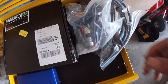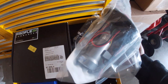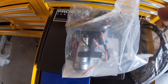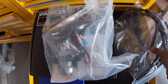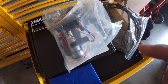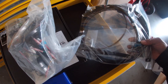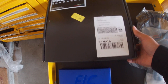I just made it back from McKinney where I picked up the new fuel pump. This is a single fuel pump — a 450 pump — and this is going to be good enough for what I'm trying to do right now, until I need to add a second pump or do the return style. I'm probably gonna have to figure out some different fuel rails for the return style because I don't think the 36 has the necessary fitting size. This is the harness that it comes with; it also comes with a relay and screws to help separate the hat and install it.